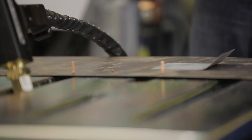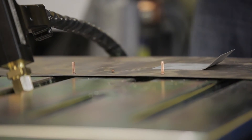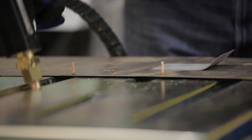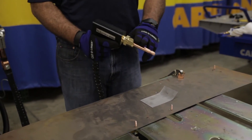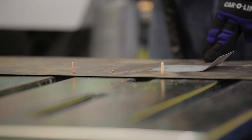Now we're going to look at the single-sided welding on the multifunction gun. Single-sided welding can be used for non-structural or cosmetic applications on vehicles. To begin, we have our ground attached to what we'll call panel A. Then we're going to use our positive or welding electrode on panel B, the panel that we want to weld to panel A.